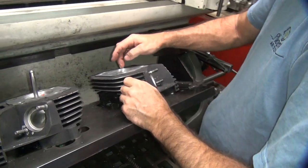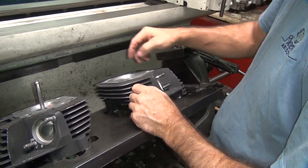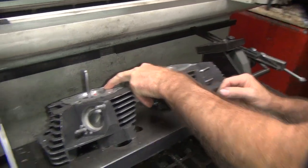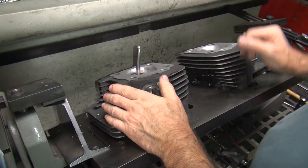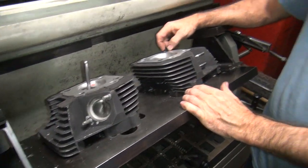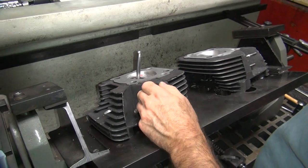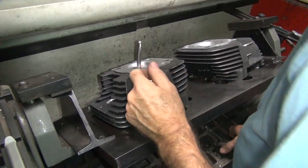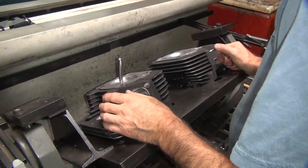The biggest thing is you're going to gain a lot more low and mid-range power from cutting out like that than you're ever going to get from being constipated like this. But you can see how the combustion chamber is in a completely different shape now. You know, we took out a lot of compression — that's over a point, I'm sure. It's 8 to 1 now, and I don't really care. Probably have too much in it anyway.